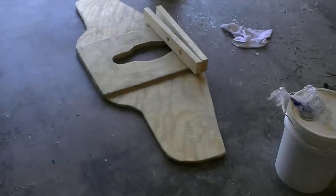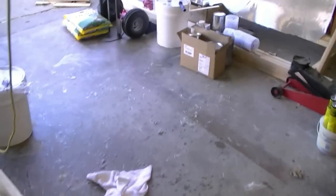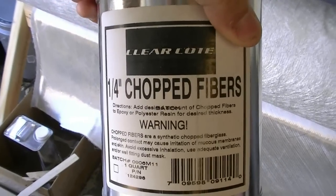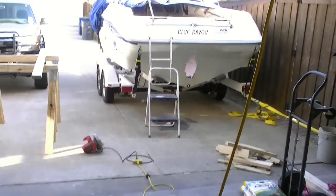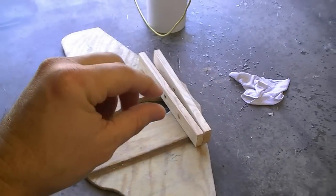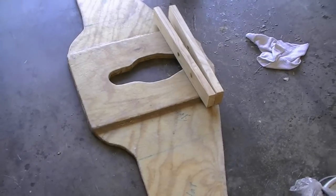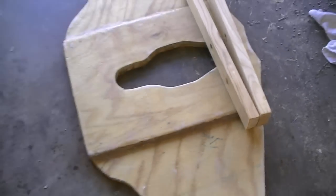I've had a change of plans on how I'm going to glue this transom in. I'm going to mix up a mixture of poly resin, some chop strand, chop fibers, and cabosil to thicken it up and make a peanut butter-like glue. I'll put it on both sides — one on the transom and on the boat skin. The boat skin has lots of undulations that are really hard to fill. With PL adhesive, when you try to make a seam and it cures, it bubbles up and makes uneven spots that are difficult to sand. So I'm going to use this peanut butter for filleting the transom, and I like the way it came out.